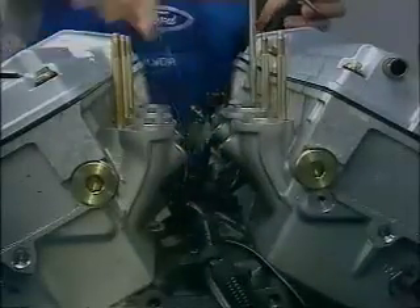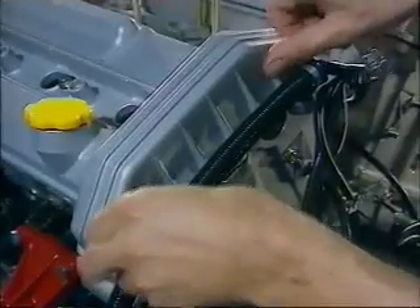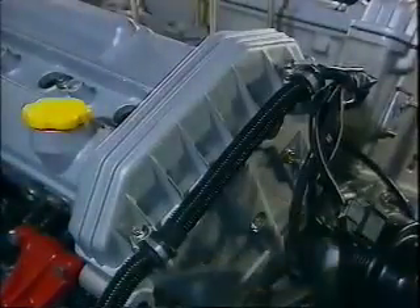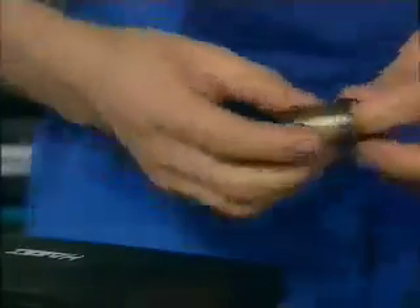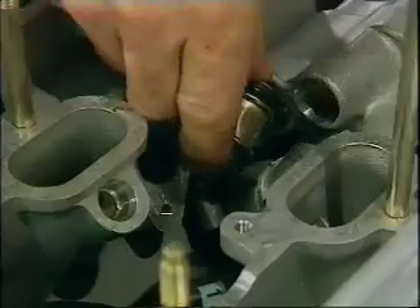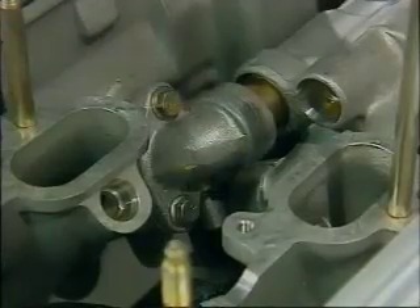None of the final items to be assembled present any difficulty. It's more a question of getting things in the right order, although the wiring loom can go below or above the thermostat housing. As to the thermostat housing, don't forget that the spacer tube that connects it to the left-hand cylinder head will need new O-rings before it's installed. A useful hint to help install the water hose that runs between the left-hand head and cylinder block: a bit of soap will make it easier to wriggle the hose into position, as it is quite a tight fit.